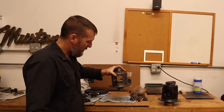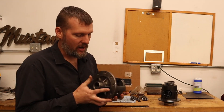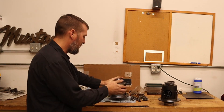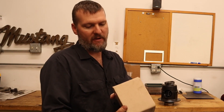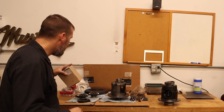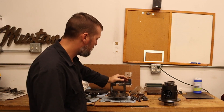Here I have a ready-to-go stock differential — this is the Ford Traction Lock. This is one I went and picked up from a junkyard, got it nice and cheap. I've taken it all apart, cleaned it all out, and I'm going to rebuild this. Got the carbon fiber clutch kit, the M4700C — the Track Lock rebuild kit carbon for 8.8. We'll put all new clutches in there, get them in the right orientation, and get this thing all rebuilt. I haven't done one of these before, but reading through it, it seems pretty easy.